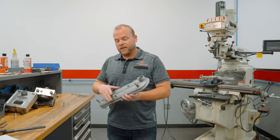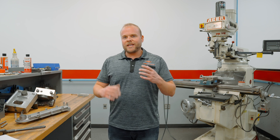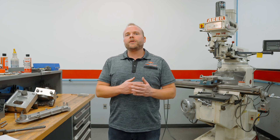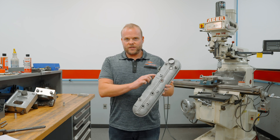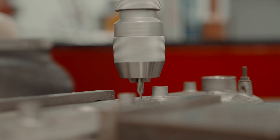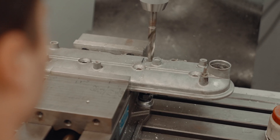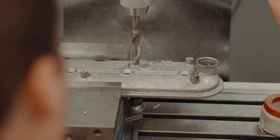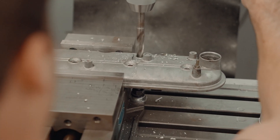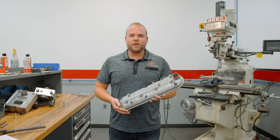On the other side — the right side of the engine, or passenger side in the United States — we're going to do the same thing, except we're going to go 0.625 inches in from the inboard side edge and also 0.60 inches forward towards the front of the engine. That's where it goes on that side because on the LS engine the ports are offset a little bit. Same deal — it'll allow you to drain the oil directly back into the valve cover without having to run an oil line all the way back to the oil pan.